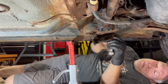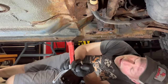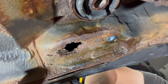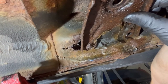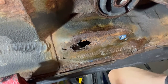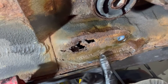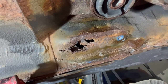It looks like I just need to re-tap this hole out and it'll be fine. Look at this rot hole — that's where I just removed the plate from. That plate was originally sitting up just like that, and you can see a big old rot hole there. On the back side of the plate you can see where the bolts are still stuck in the plate. So I'll cut all the rot out of here, put some new material in and a new tapping plate, and that'll fix that part.